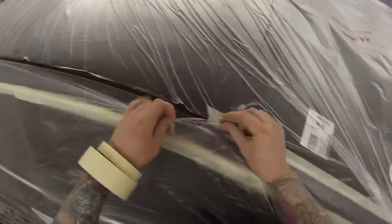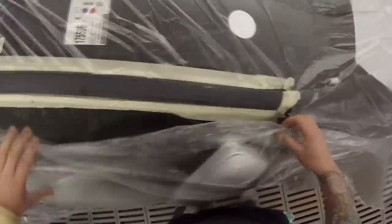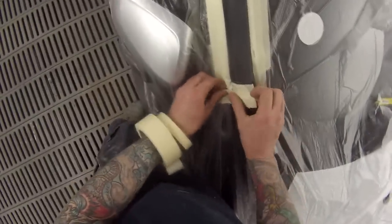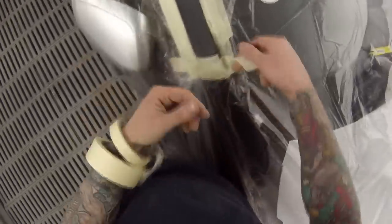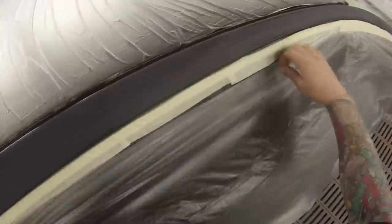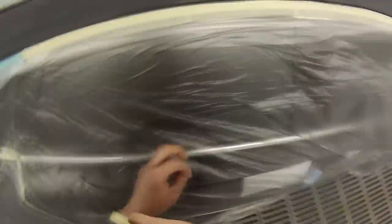This one works fine most of the time and it's good quality. Once I've got all my edges done, throw a piece of plastic over the entire car — make sure you use a nice sharp razor blade and be extremely careful. I only had a small section of the blade exposed and I had my thumb on the actual paint itself. I like to use my 36mm masking tape straight over with the plastic — it saves a lot of time, just a quick matter of slicing it out and taping it down, rather than the old way of going around with loads of bits of paper and then putting plastic over the top.